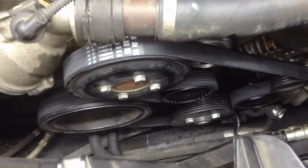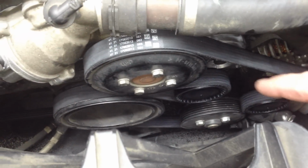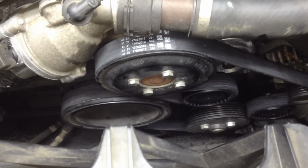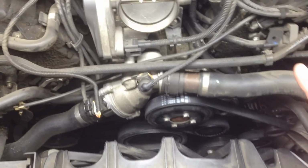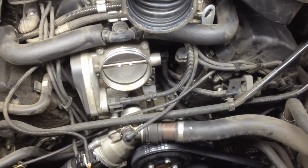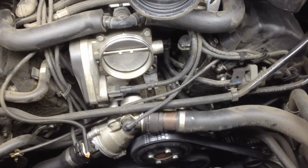And again, guys, always examine, make sure the teeth of the belt are on, evenly spaced around. Again, look for debris, blow it off if necessary. Alrighty, looks good. Always double check your work. Pulley looks good. Alright, guys. Now, I'm going to put all this back together here. Very simple, guys. Very quick. Probably if I wasn't filming, I could have done this whole project in probably 30 minutes, maybe 35 minutes.